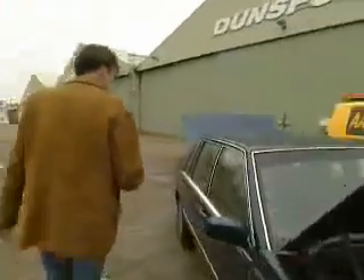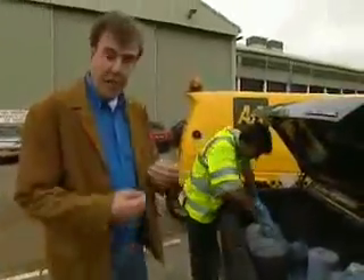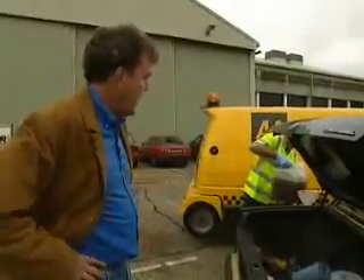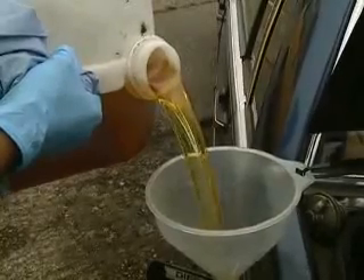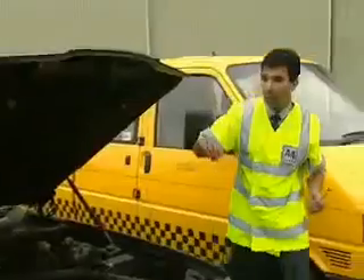Well, if we go around the back and look in the boot, we find a big container full of vegetable oil from El Rios in Macclesfield. We've added a splash of white spirit, and Bal is going to pour that into the tank. It's now been converted from a carnivore into a herbivore. Being a diesel, you can't just start it — you have to bleed the system first, which you've just done, yes Bal? Yep, all ready to go. System bled, no airlocks in there.